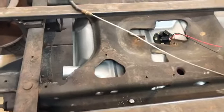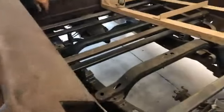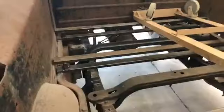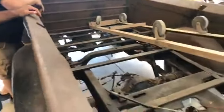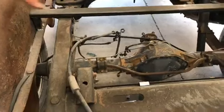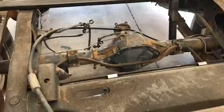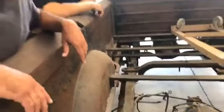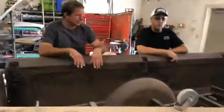Where the spare tire was underneath, this works great. If you look at the bed, you can see we did a false floor — you can see the gaps where we double mounted. Chad will be able to take a rusty old piece of sheet metal to match the rest of the truck and mount it on there, giving a nice flat finish bed to finish it out. And something else while we're looking back here on these Dakotas — one thing about these early 2000s Dakotas, they were set up with a V8. This thing has a heavy-duty 12-bolt rear end under it. It's a smaller frame to work with, but it's basically a half-ton pickup — just as good as using something bigger, just easier to work with. And like we discussed in another video, they're really easy to shorten and fit to what you want to do wheelbase-wise, which makes your life a lot easier trying to put the puzzle together.